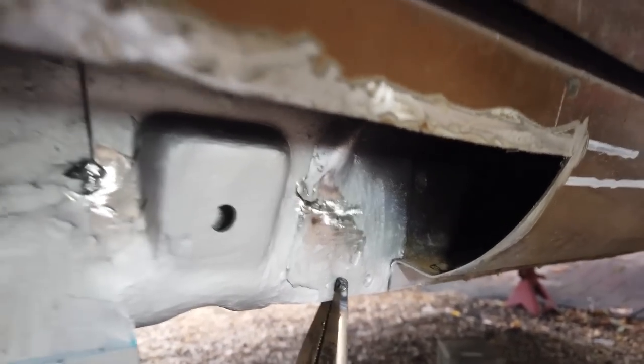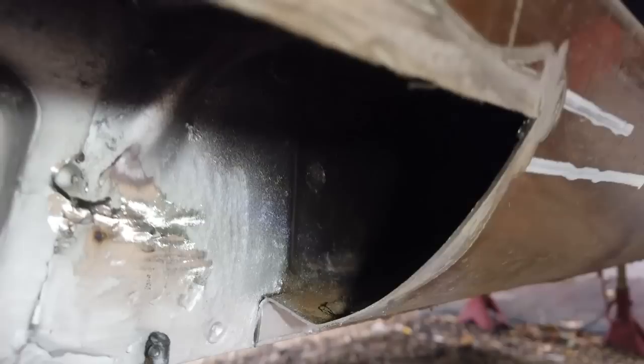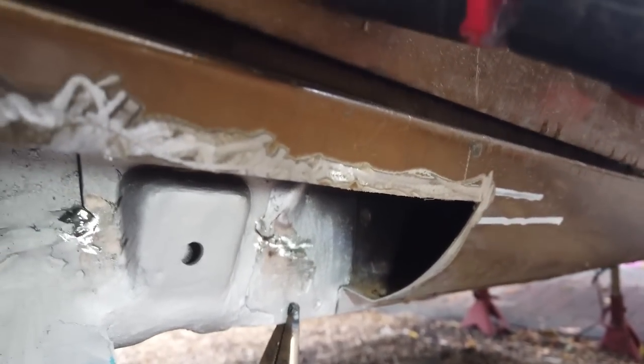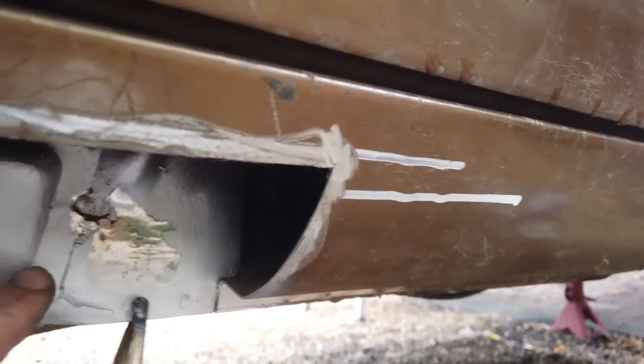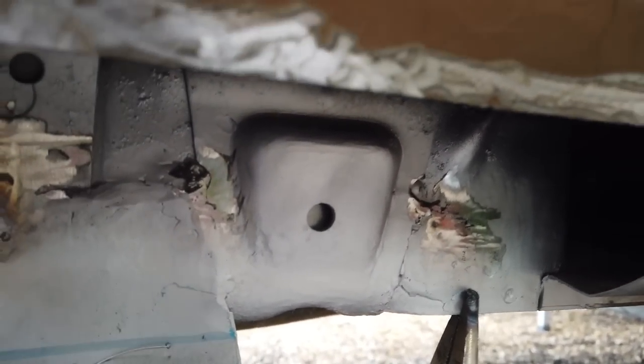You might have to slit and skim in. You'll not get that to go with a copy sill exact. The profile, the pressing's just not the same. It's not far off, to be fair. So once you've got yourself set up, you take it all off again, and you're happy with everything here, and that the jacking point's solid and de-rusted.